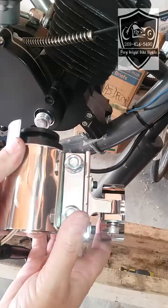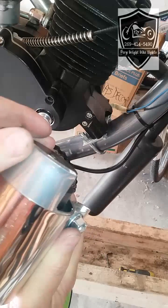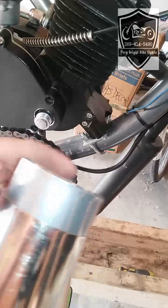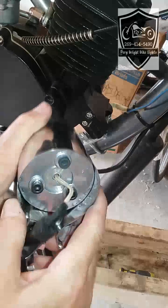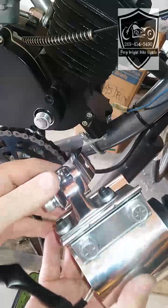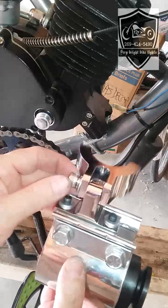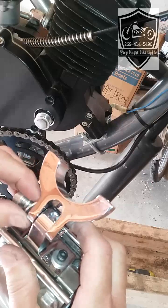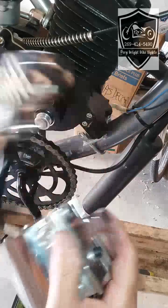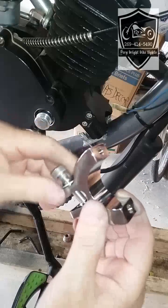Here's the alternator that comes with the kit — you can see it's got the chrome cinch on the outside. The guard is not going to be 100% perfect because they're made by me — I make them and powder coat them here, but you can't see it inside the chrome cinch. It comes with the mount. Before we mount this, you need to take this bolt out, and I'll show you why — because you need to be able to take this off and set it aside for now. The reason you take it out is because it's going to be a tight fit putting it on the frame.